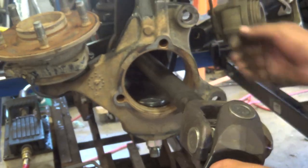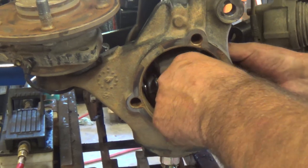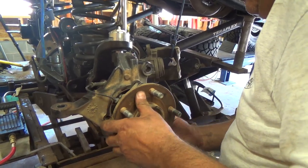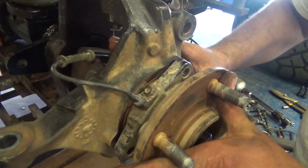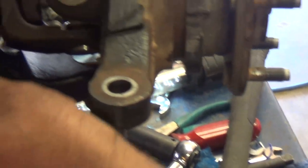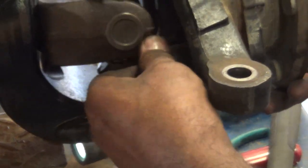Other than that control arm bracket, I did have one other issue, and that was the passenger side quick disconnect. I run TerraFlex quick disconnects, but I don't think it matters because any disconnect would have a problem. There's just no room to disconnect it, and the mounting tabs for the disconnects or for the links are further outbound. So instead of having them point outwards like I had them before, I had to have them pointed inwards. Which makes it impossible to get it on and off on the passenger side.